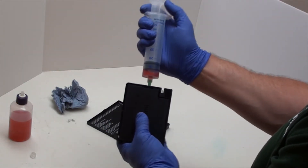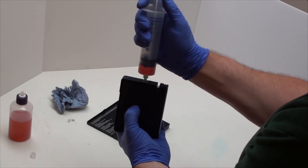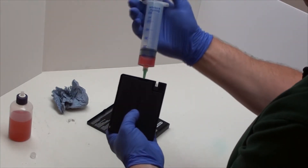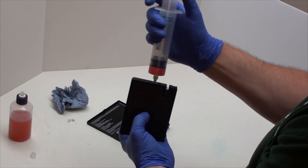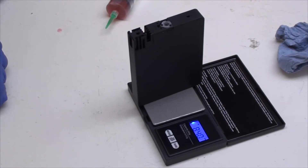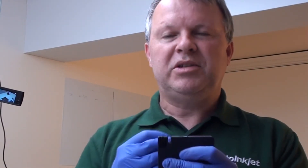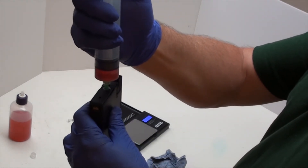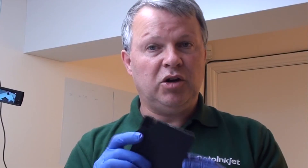Not that it should make any difference, but let's be careful. Just pull back a tiny bit and try again — a tiny bit too much, so one mil in. Just spilling a little bit of ink there. That hopefully will be sitting — bang on — 84 grams. Now you don't really need to be worrying about that too much; I'm just doing it for demonstration purposes, but 84 grams is your target weight. What you don't want is a lot of positive pressure in here, so you definitely don't want to be looking at 90, 95 grams because the bag will be bulging and positive pressure pushing ink into the printer — probably wouldn't be a good thing. Do be careful to remove any air just at the end by keeping your cartridge upright, sticking the adapter in and just gently pulling anything out. You may need to tip the cartridge a tiny bit each way just to make sure it's moving and pull it out. Small bubbles of air aren't going to be a problem.